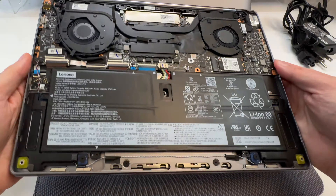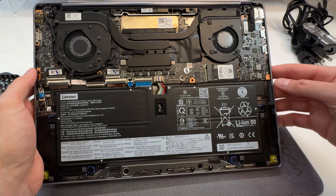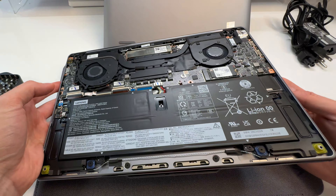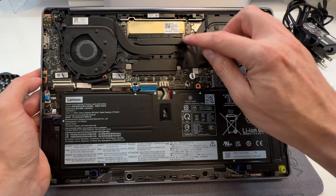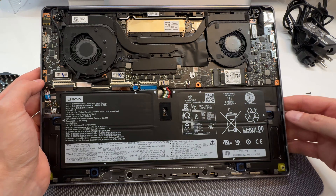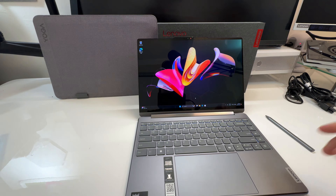The cooling looks good — two heat pipes, nice big fans with dense fins. This is just a Core Ultra in a thin chassis, not a gaming laptop, so they're a little bit limited by the thickness of those heat pipes. If you watch the G14 review I did, that claims to be a gaming laptop and also had pretty thin heat pipes, but it's a totally different class of laptop.